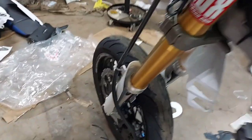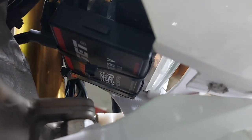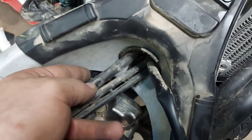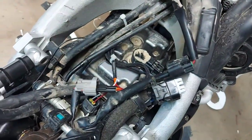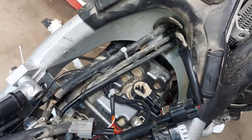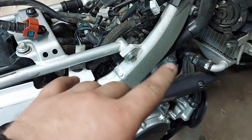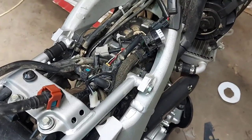We are well in the process here — got the Power Commander mounted right up in there just like the old YouTube says to. Blew the headlight. Got all my harness ran down the side, behind the coolant reservoir, and then up under the frame. It's a mess of wires, but essentially you just need your crank position sensor, ignition coil, fuel injector, throttle position sensor — and there are plugs that go in line of all those to give the reading to the Power Commander.